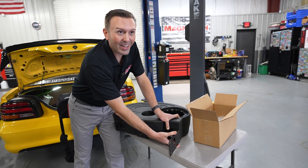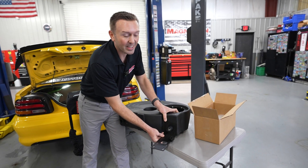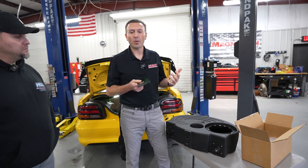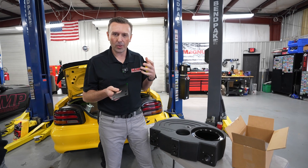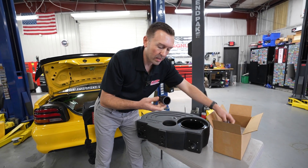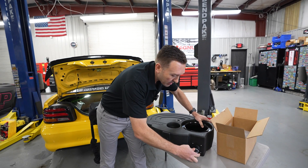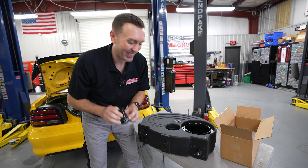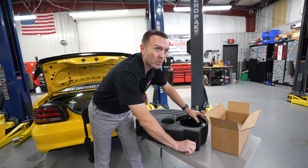Our engineer Jake is actually behind one of the cameras. This orientation is critical for proper mounting of the EMP. There are actually recommended clockings for installation for aeration and cavitation inside the pump. And then we give you an offset silicone reducer from one and a half inch down to one inch — that's what the EMP is. Does the offset go towards the bottom or towards the top? Towards the top.